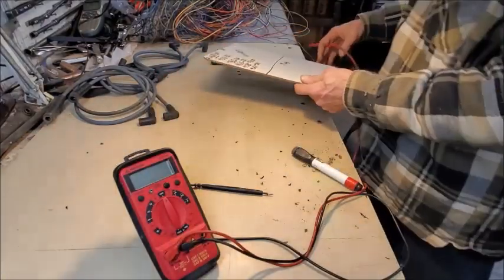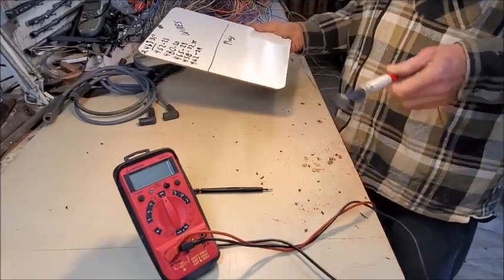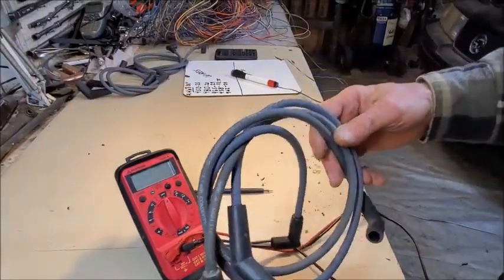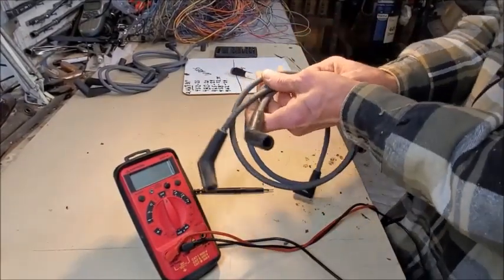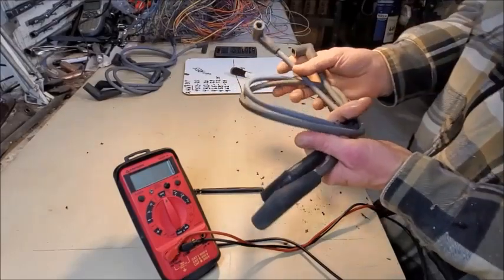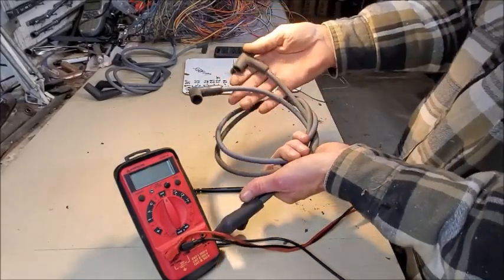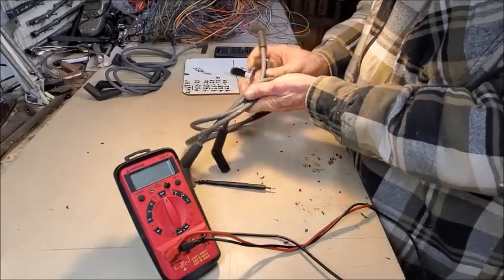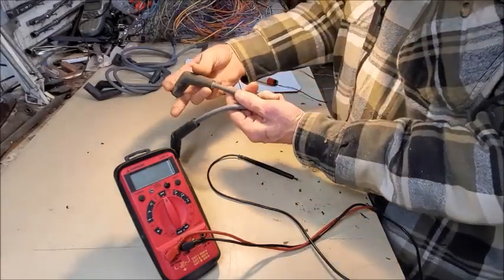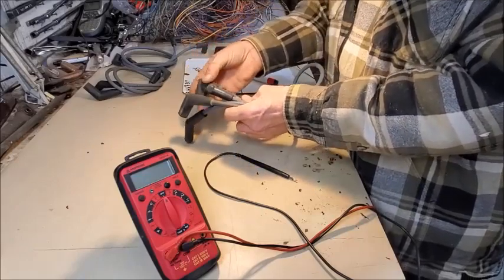With that being said, let's analyze our old wires and our new. Here's a set of spark plug wires — remember there's a new wire and an old wire in there — and I want to call this my longer wire on my engine. So one is brand new and one was the old existing. The new and the old are identical in length, and my length is 33.25 inches. We're going to do the math on this and see what's going on — could my plug wires have been the fault?